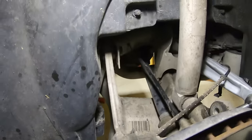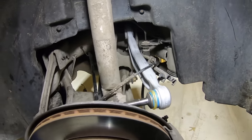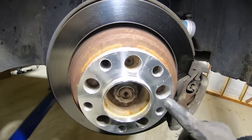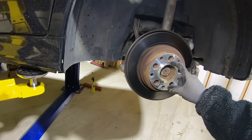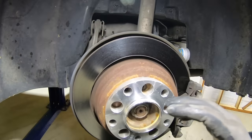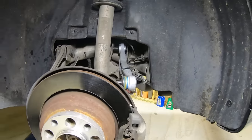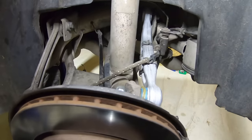The forward toe arms look actually all right. Sway bar links aren't making any noise but they look kind of original — keep an eye on that. We did ceramic brake pads on this thing; the rotors we did not do but they were good. There's our 19mm adapter/spacer that adapts it to 32mm — can't remember exactly, I think it was 62 to 64 — it adapts down so you use a regular wheel. These designs have a bigger center hub so this comes out a little bit and actually adapts down to a smaller hub. I'll reinstall this and we'll be right back.